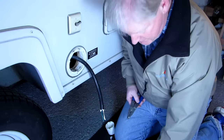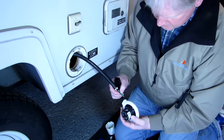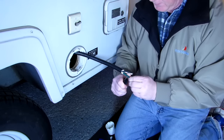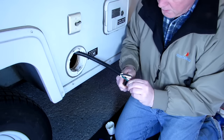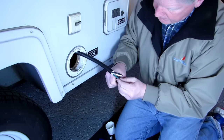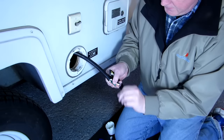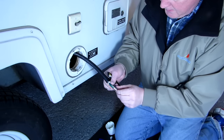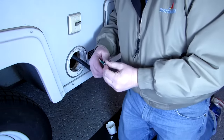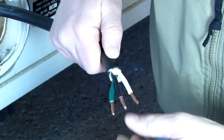By the way, whenever you're cutting wire, you should make sure the power's dead. Now I'm going to strip these about a half an inch. You could read the directions, it probably tells you how far. I'm just rolling them on the knife blade to cut through. One side is always harder than the others. And then just give that a couple of twists to keep it in good shape while I do the others. I can fold that over. And there it goes. So there's three wires stripped nice and clean. They're in good shape. They're not all frayed up.